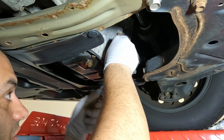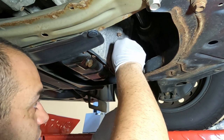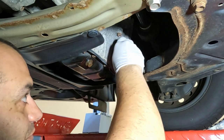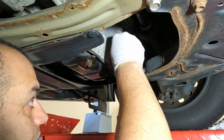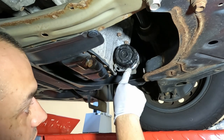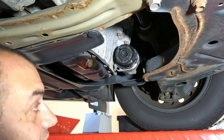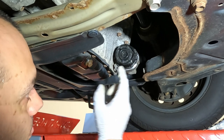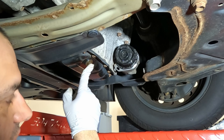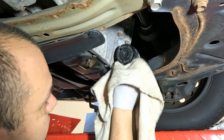This is a pretty simple oil change — you need a couple of specialty tools, mainly just the 64-millimeter adapter for these things. There's a bunch of different styles and versions of them. Most places carry it since this is a Toyota vehicle, very popular obviously. The black housing is almost perfectly parallel with the mating surface — there's 18 foot-pounds, properly torqued. You definitely don't want to over torque these because they're a real pain to get off. So we're all buttoned up: new filter, new O-ring, tightened to 18 foot-pounds; drain plug tightened to 27 foot-pounds. I'm just going to wipe everything down one more time to make sure we don't have any false positives for oil leaks.